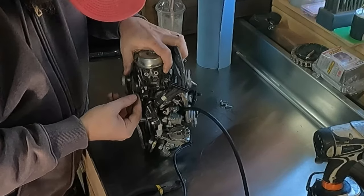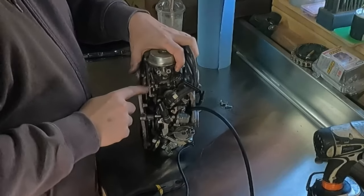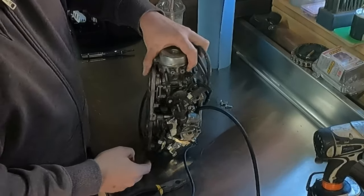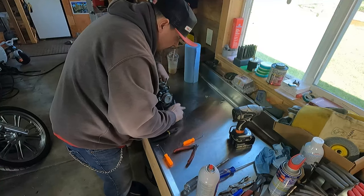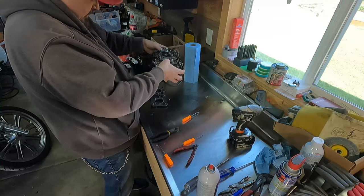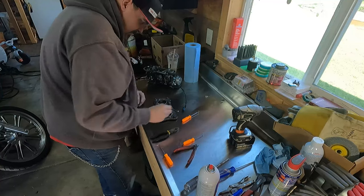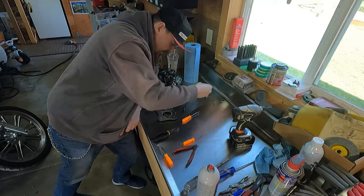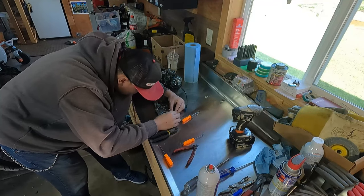Okay, when you pull it, there's a little plastic stay on here and another pin set up on the other side. What I'm gonna do is pull it and put all that back on the ends of these rods. And the little washer right there, pull that out. And now the top plate's off. So like I said, now that I got that off, these are those little rods I was talking about. I'm just gonna put this back on there and shove a pin back through just to hang on to this stuff so I don't lose anything.